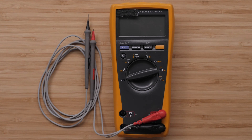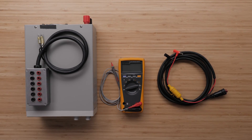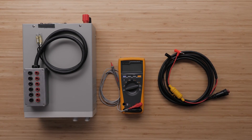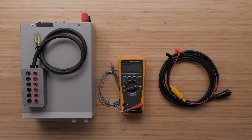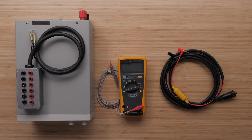As a note, simple test lights are not sufficient for proper troubleshooting. In addition to a multimeter, it is useful to have extra properly rated fuses, an extra power cable, and often times a different power source can be used to help isolate a device for better troubleshooting.